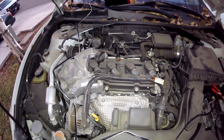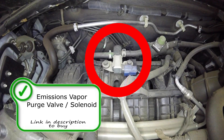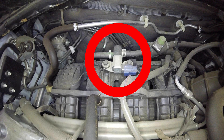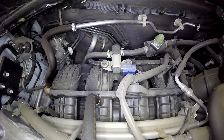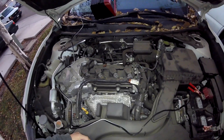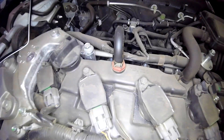To get started on the component locations, here is your vapor purge solenoid right here on the intake manifold. Looks pretty easy to replace or check if needed. When there is no voltage applied to the solenoid, it should be able to hold vacuum. A real easy way to check this is just take a hose off, connect a vacuum gauge to it, apply some vacuum, and see if it's working. That will cause a list of codes if it does go bad — lean codes, rich codes, a bunch of different stuff. Those codes will be listed in the description below as well.